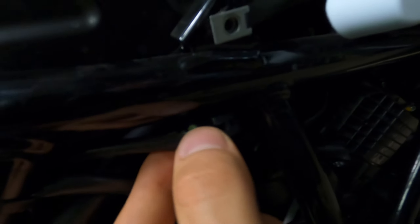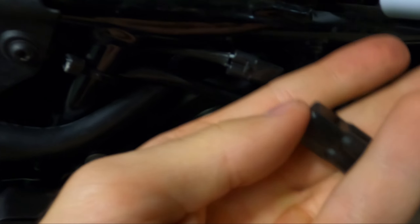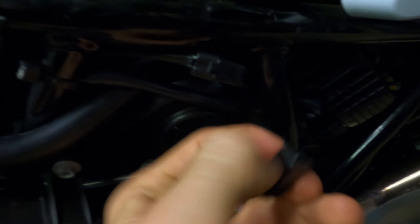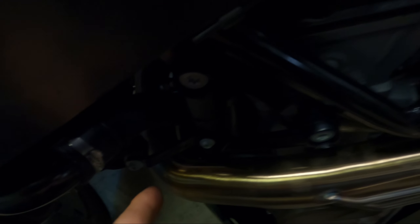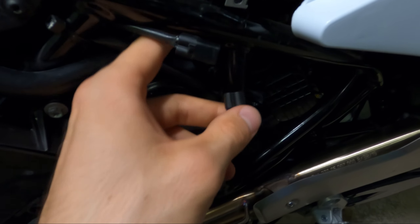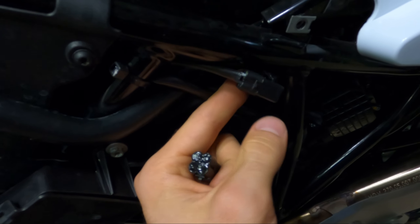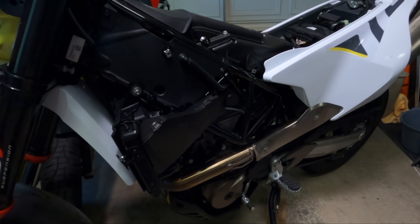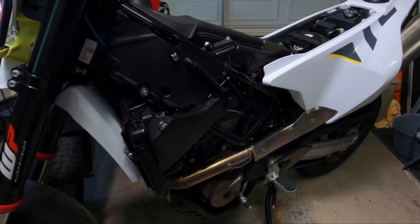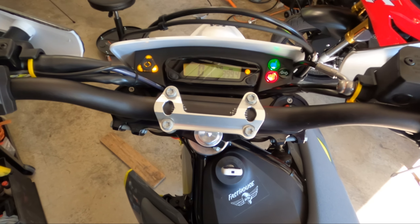It's this little green plug. I'm going to unplug this and plug in the fuel dongle. Got it disconnected — all you do is take the fuel dongle and plug it in there. If you ordered one of the caps, you'd pull the wire out, take your O2 sensor out, and just cap it. I'm leaving it in for now because I'm going to a power commander soon and I'll remove it then. There you go — installed, done. Super easy install. Let's start it up and make sure we don't have a check engine light.